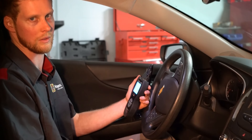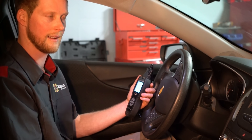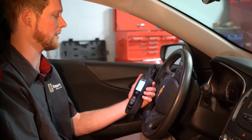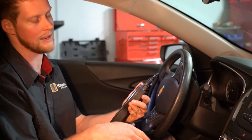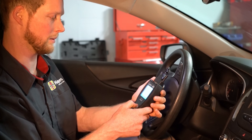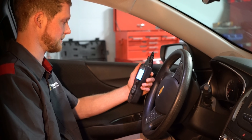So we got the codes displayed, and what we're going to want to do is write them down. Realistically, it looks like we got two codes to diagnose. Luckily, we don't have any intermittent codes thrown on this car — sometimes cars throw intermittent codes where the check engine light comes on and then goes off, and you've got to catch that at the right time with the scan tool. A little more difficult, but in our case we got lucky. Once you have the codes, write them down, diagnose it, and hopefully fix the problem based on what your scan tool reads out. Now once we have that information, we can go ahead and clear the codes — and it's erasing. We got the codes cleared. Let's fix the problem.